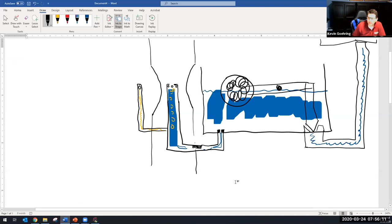Getting ahead a bit — if I wanted to change the fuel level and I can't bend anything, this is more representative of the Stromberg style. If I raise the seat up, it means this is going to shut off sooner. So raising the seat lowers the level. The way to raise the seat is to put shims under it. If I want the level higher, this needs to plug off later — so I would take away shims. Raise the seat to lower the fuel level; lower the seat to raise the fuel level.